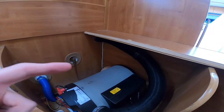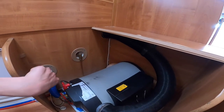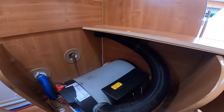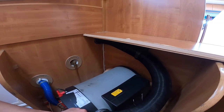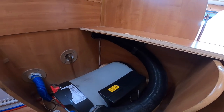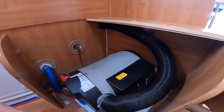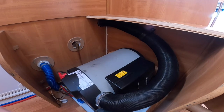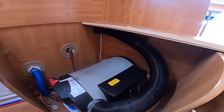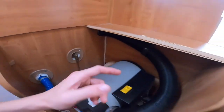Open the fresh and waste drain outside. When you come to reuse it, shut the taps inside, fill the vehicle with fresh water from outside via a hose pipe, come in, put the main control panel on, put the pump on, and go to the cold side of the tap — you'll get automatic cold water as it's filtering from the tank underneath the vehicle via the pump to the tap. Go to the hot side of the tap — it'll start to cough, splutter and make all sorts of noises. What that's doing is filtering it from the tank, filling this boiler with 10 litres of water and pushing all the air out through the tap until you get a free flow of water from the hot side. Do all your taps on the hot side and once done your system is primed for the season.